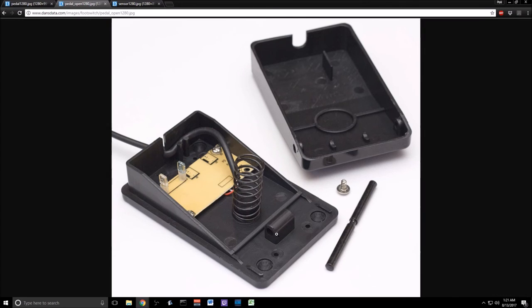The moment I started using it, it was designed so that it could sustain the upward reaction force when you push it down, but it wasn't designed to survive under a shear force, which is basically what you're going to do whenever you push down. It's not just going to be an up and down push. You've got to push it at an angle, and so I used some metal ties to get this hinge back in place, and it works perfectly fine for me now.